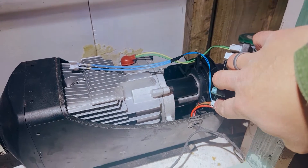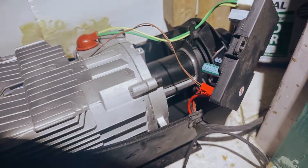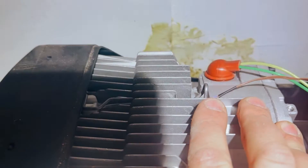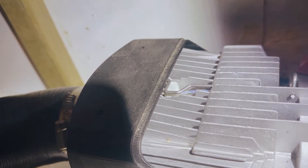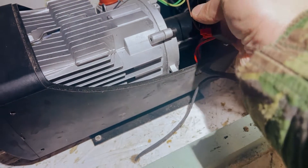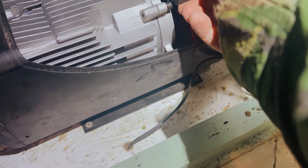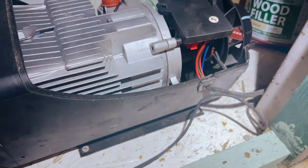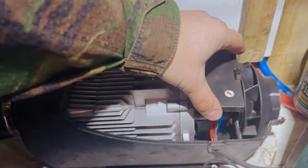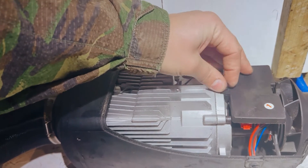You can take it off and put the new sensor on. The new sensor is in, as you can see there. The clip is back on, and it's plugged in there with the red plug over there. Getting this clip back in is a little bit of a pain — you really need two hands for that. You can see how the clip sits on the top of that temperature sensor, which holds it down against that manifold heat exchanger to keep an eye on things. I'm going to get this back over here and clip down, and then put my M5 or M6 grub screw back in there.